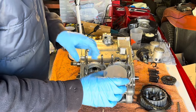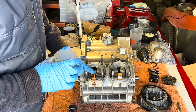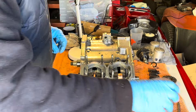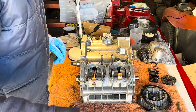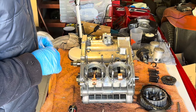I've got myself a small amount of two-stroke oil. I'm just going to put a little bit in here on the bearings and in the bottom of the crank just to lubricate that. I'll also put some two-stroke in for the little end bearings and smear a little on the cylinders as well, just to help everything go back together.